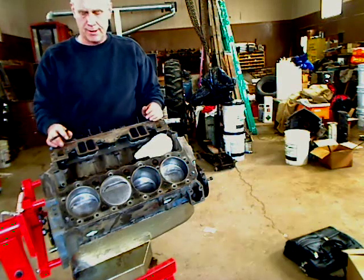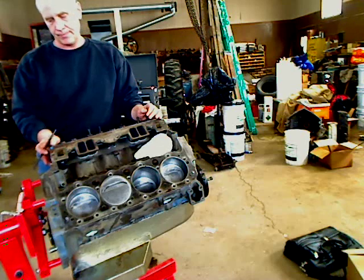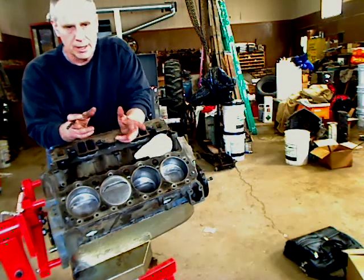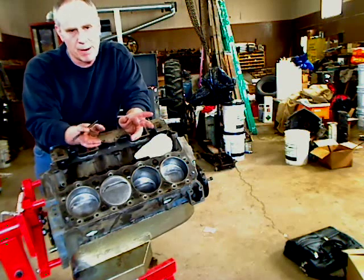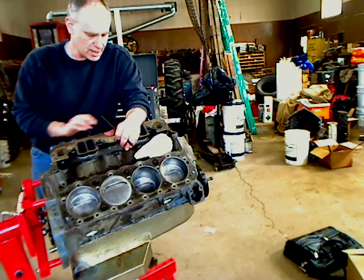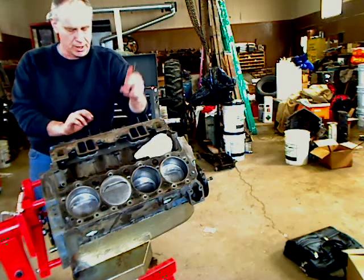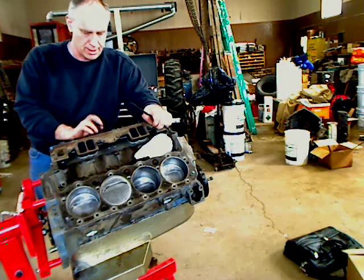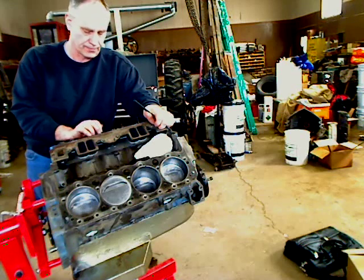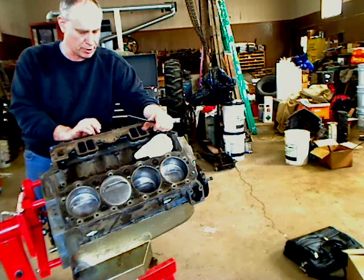One of the things we've already done is used an old head gasket — it's already been torqued down, it's crunched, it's proper thickness. So that way we can just put the head on and tighten it down with like four studs, just snug it down. We also run pushrod guides with rocker studs. You want those in there too — same thing, just snug, you don't have to be all torqued down.